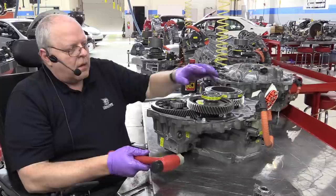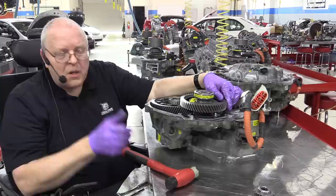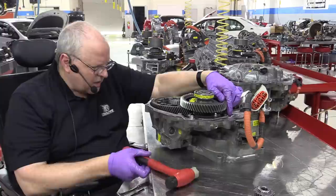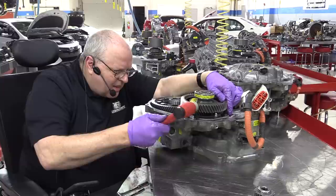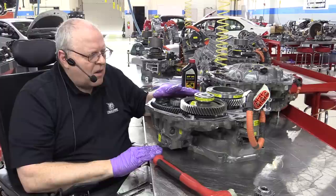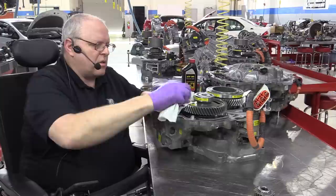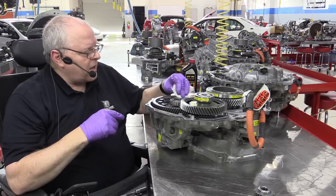All right, I don't like hammers, as I've described in previous videos, especially pounding down, because we can damage the bearing surfaces and the bearings themselves and cause brinelling. But if we tap sideways, it's getting there. There we go. Then we're just lining the bearing up with the case, and the chances of causing bearing damage and brinelling is much lower. The tendency, of course, is to pound down. Pounding down on it does not help anything at all. It just wedges it in place.